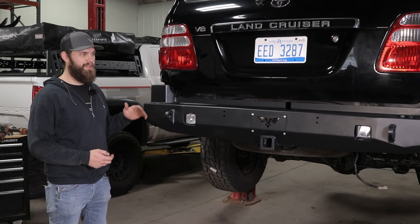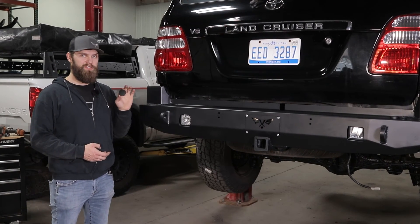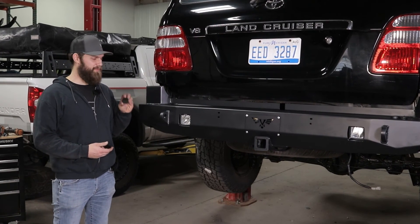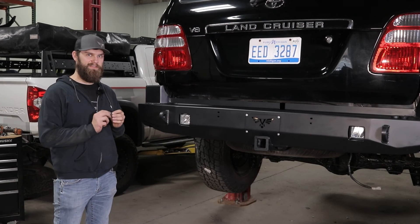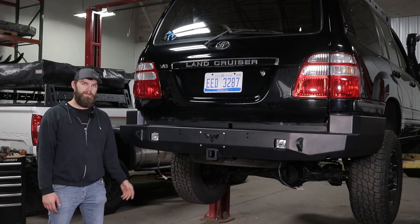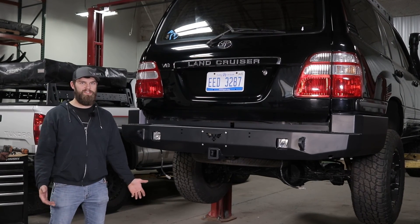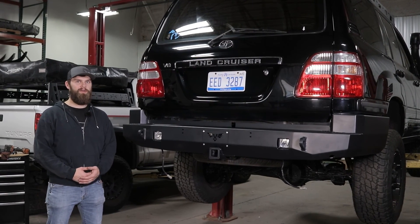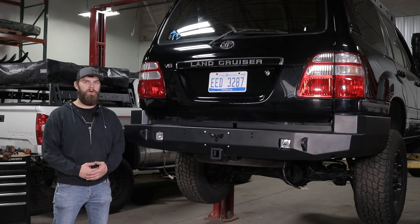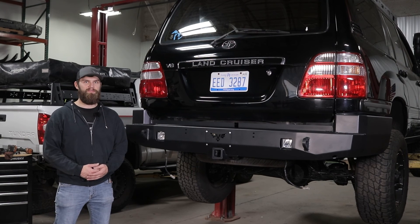If you're going to be installing carriers at this time, you can go check out our Adventure Carrier video. If not, be sure to install these black plastic caps both top and bottom with a little bit of RTV sealant to protect that spindle sleeve so that you can install one later. Now you can wire up your lights and that'll complete your install. If you guys have any questions, feel free to email us at info@victory4x4.com or give us a phone call at 269-459-8447.